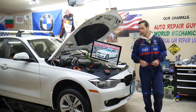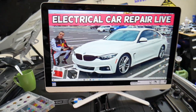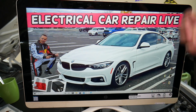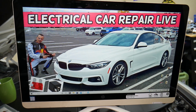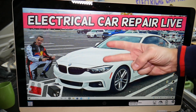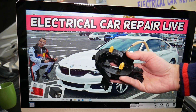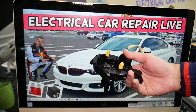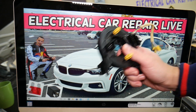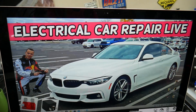So what do we have here? Specifically, a 2015 BMW 4 Series that we'll demonstrate on. The things you need to check first: Number one, the brake light switch. A bad brake light switch can turn the traction control light on — we have a video on our YouTube channel on how to test the brake light switch on a BMW. Number two, the steering angle sensor. You may need to reset or calibrate it. A steering angle sensor that's not calibrated will actually activate the traction control light. We also have a video on how to reset and calibrate the steering angle sensor. Number three, check the following fuses.